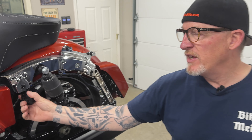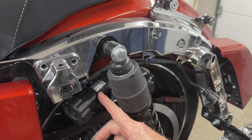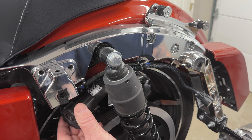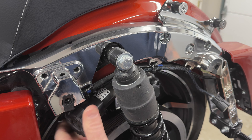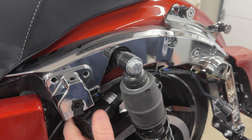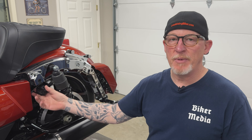The right side is set to my weight, so this knob — the hydraulic adjuster — is all the way out because I have no luggage, leaving about a 100-pound leeway. For example, if I put on 20 pounds, you can see there are graduation marks here, and it clicks as you go for tactile feedback. Line four is about 20 pounds, line five is about 25 pounds, and so on. When you take your luggage off, you can back this off. You do have to remove your saddle bag to access it — I do wish Harley would make it accessible without doing that, but it only takes about a minute.